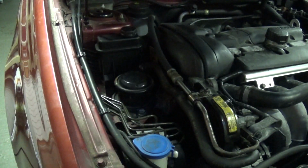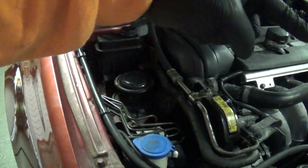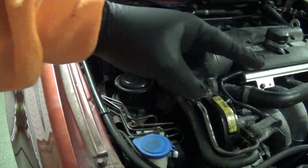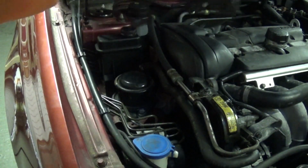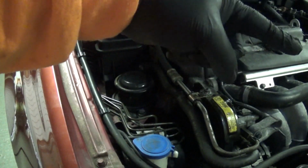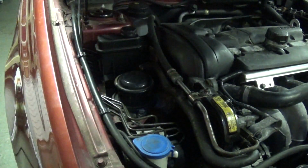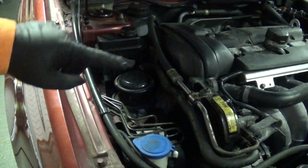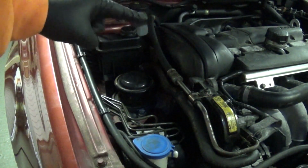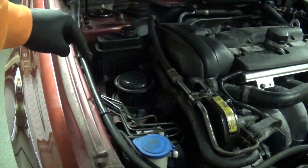Right, okay, so after you've had a good check around the engine bay, next thing I need to do is go under the car, and along the front here I need to reattach the bottom hose over there, tighten it down. Sorry, just having a small sneezing fit there. Tighten the bottom hose down, put the under tray back. Then I need to come down here into the wheel arch, first put the little guard back around the timing belt, then put the splash shield back in,